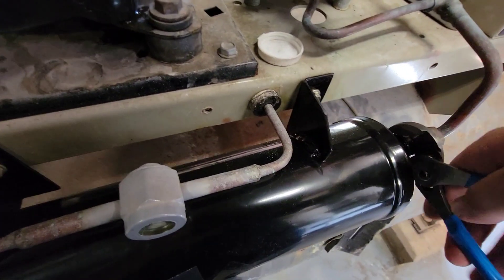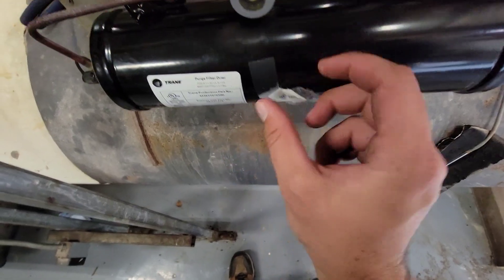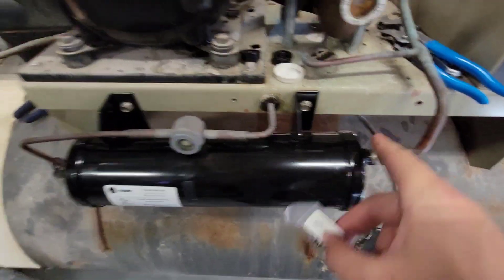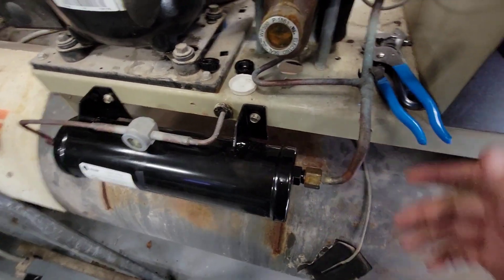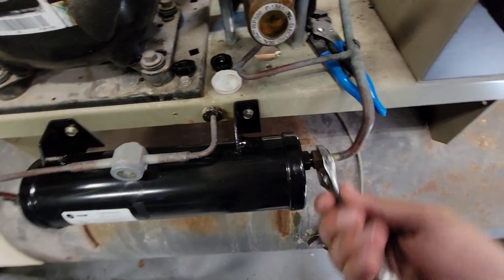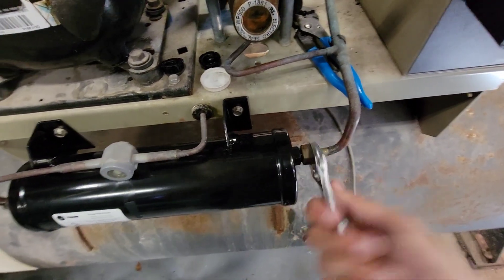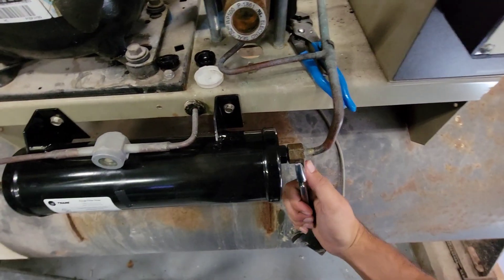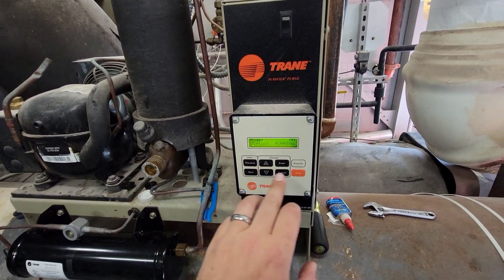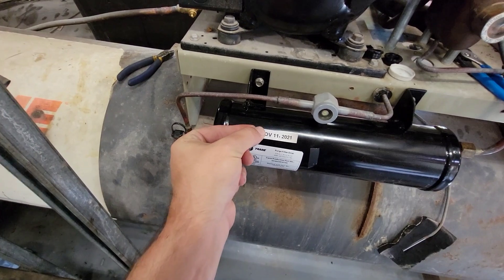Put the new one on. These caps come with two tiny little O-rings that sit right up in this little flange, and that's what makes your seal. You want to be careful when putting those little O-rings in that you really get them seated properly - I've done it to myself before where I didn't, and I ended up pinching the O-ring because it didn't sit in there like it needed to, and created a leak for myself. We'll let it go into a pump-out and run for a minute.